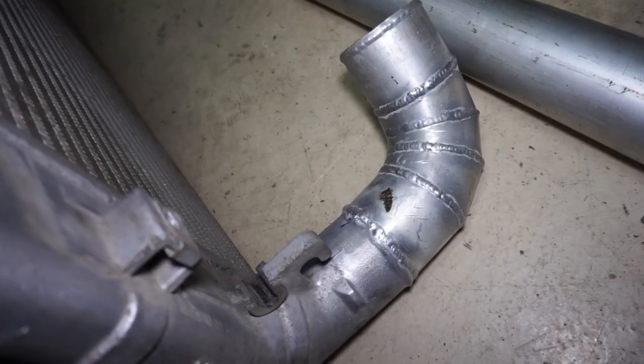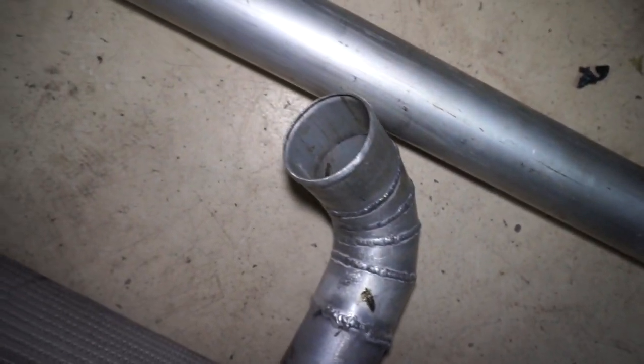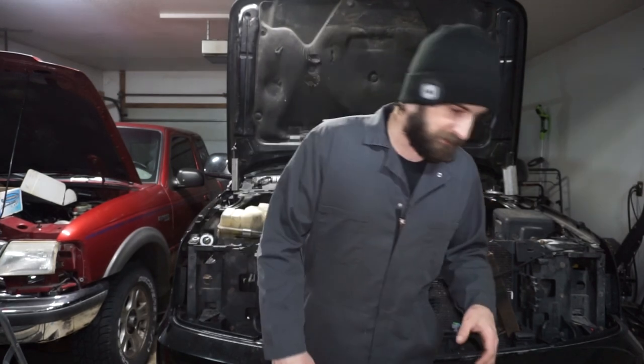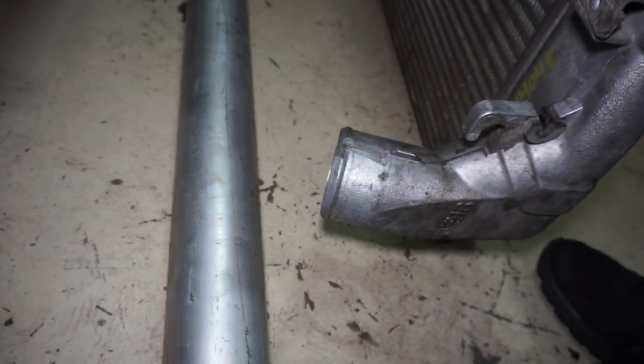What I want to do is put a little elbow on the infeed side of it, because the silicone coupler that I had was actually hitting some of the hosing in there. So I want to have that all be metal and then come straight up to the turbo. First thing I'm going to do is make some pie cuts out of this pipe, because the outfeed side of the intercooler already has a section of pie cut piping on it, so I kind of want to match the inside. I have some shiny intercooler piping with a 90 degree on it, but I want to keep it consistent — this aluminum here isn't polished, so it already looks a lot like the intercooler. After it's welded it kind of looks like it was supposed to be there.